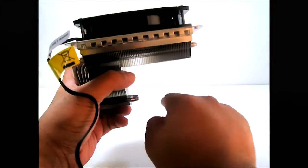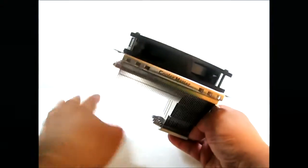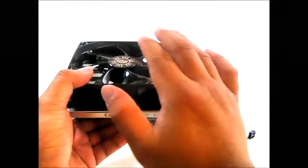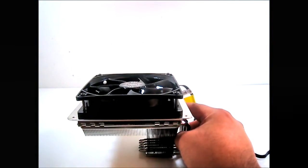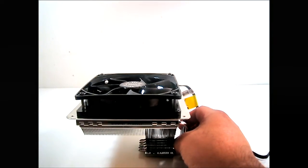What you can do is, if your motherboard is facing this way and your RAM modules won't clear on this side, you can probably mount the heatsink the other way, with the overhang going over the back side of your motherboard, if there is enough clearance. Since it's a downward-blowing cooler, it won't affect the airflow anyway. And that's it — let's now install this Gemini 2 S524 heatsink into our system so we can run some benchmarks.